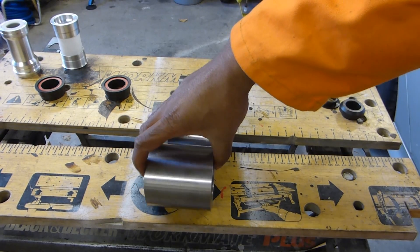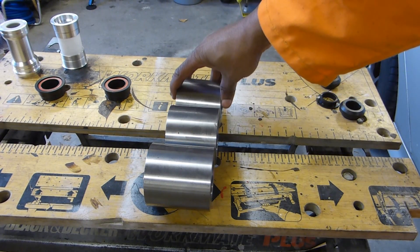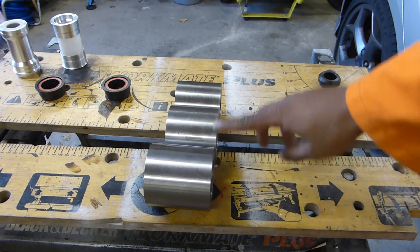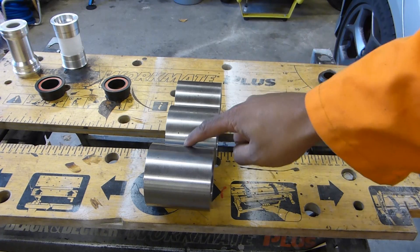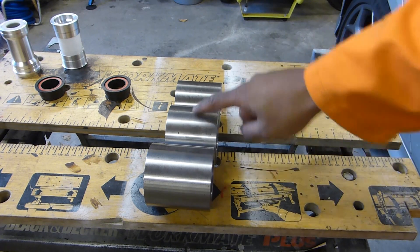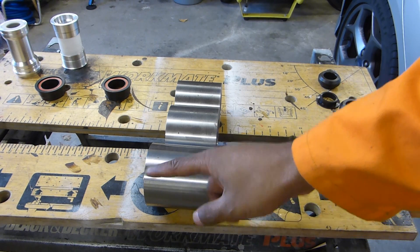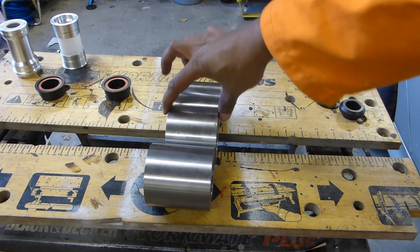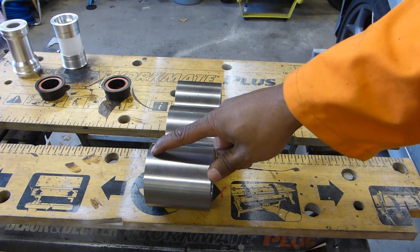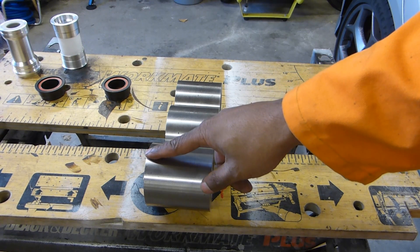The reason I've lined them all up is to illustrate a point. The drive side on all of these bottom brackets locates at the same place — basically the centre lines are the same. The difference is on the B-Right bottom bracket: it's 11mm wider than these two. These are 68mm wide, this one is 79mm wide, and that extra 11mm is only on the non-drive side.